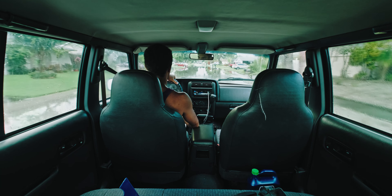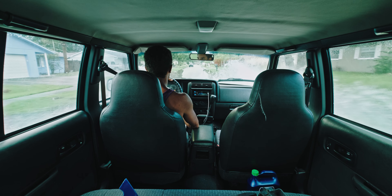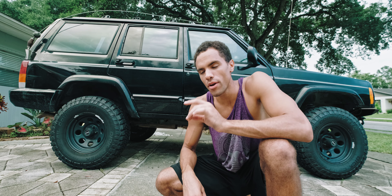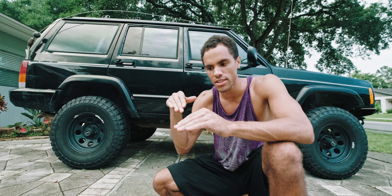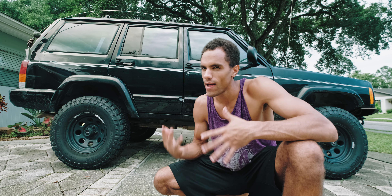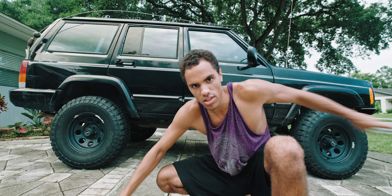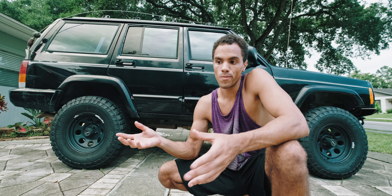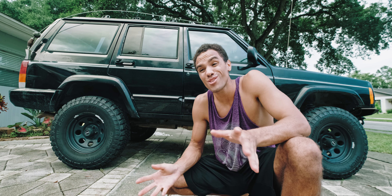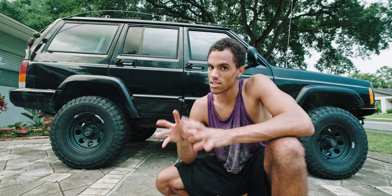I wasn't really able to hear the sound I was hearing before — it would happen when I just released off the gas for a split second and then go away. I think it's because the axle shifts a little bit and hits that point where it doesn't like it, then goes back. But I didn't hear it. However, that didn't get rid of the ratcheting noise. The ratcheting noise I think is coming from the transfer case, so I'm hoping it's a U-joint and not something within the actual transfer case itself. I can't even get one thing fixed fast enough before something else fails.